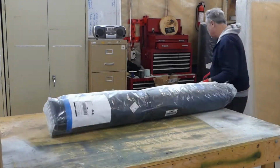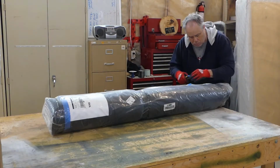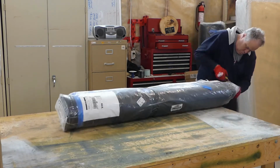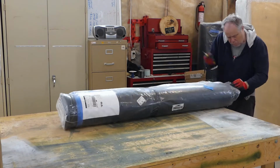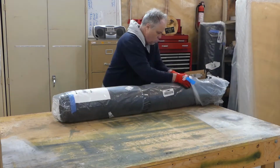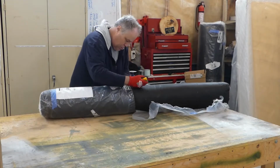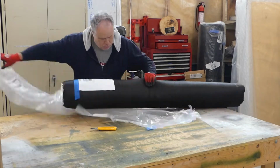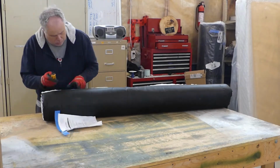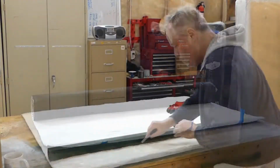Here I'm using 3M Thinsulate Acoustic Thermo Insulation SM600L. I've provided a link in the description. The material comes 5 feet wide and can be purchased in 10, 20, or 30 foot lengths. Calculate what you need and order accordingly. The material arrives compressed in a tight roll and will expand to about 1 3/4 inches. Not only does it have insulation properties, it will also create a quieter vehicle environment.